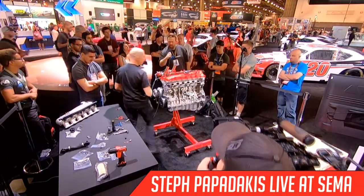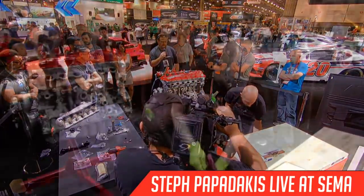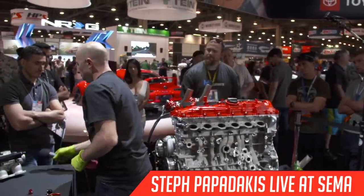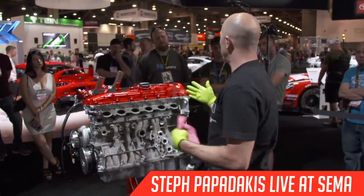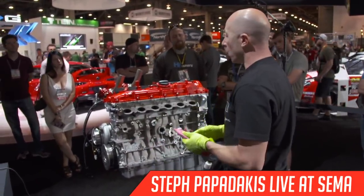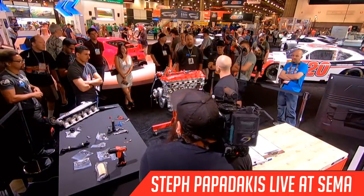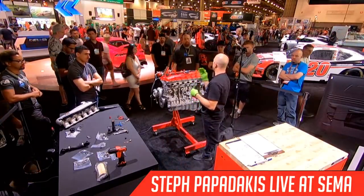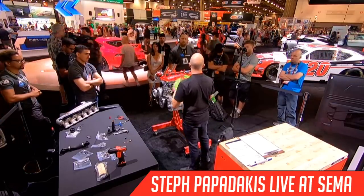With the wheel speed sensor on the turbo, are you guys just using it for monitoring, or do you have any cutoffs associated with it? Yep, so the turbo speed sensor, we use it to make sure that we don't overspeed the turbo. And then we can also use it for sometimes troubleshooting. So maybe we had an intercooler end tank break open or something like that. Or just maybe we're not getting boost and the turbo's not spinning. So you can use it for both. But typically we're just making sure that we're not overspeeding the turbo, especially when you're near the maximum output of the turbo. You can have reliability issues if you're going past the designed parameters of the turbocharger.